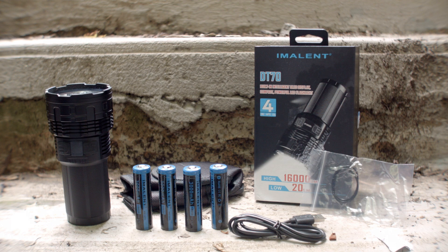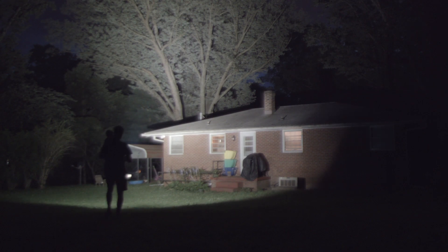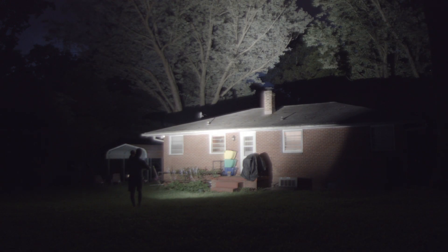A timelapse shows it takes about 7 hours and 33 minutes to charge via USB. The ending voltage on that charge was about 4.15 volts — which is safe, but not quite the full 4.2 volts. The battery indicator blinks to show a basic charge level. I use a separate charger for faster charging, and the included batteries only for testing.